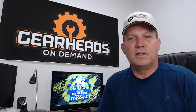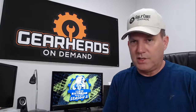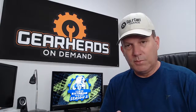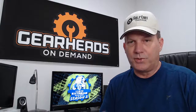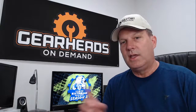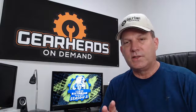If you take it to a Club Car dealer, they can plug in their little Club Car computer. Your cart has a diagnostic port on it if it's an IQ system, and they can tell you if your MCOR is sending the WOT signal to the controller. Now, WOT stands for wide open throttle. That MCOR sends a signal to the controller, and if the controller does not get the WOT signal, it's not going to give the WOT signal to the motor. So you've got to fix the MCOR.